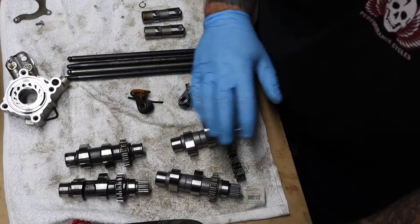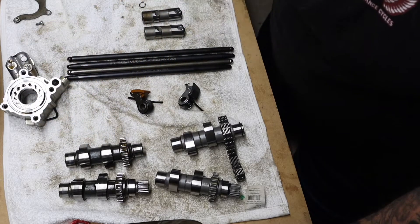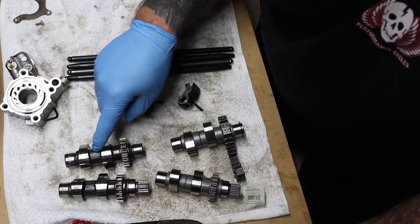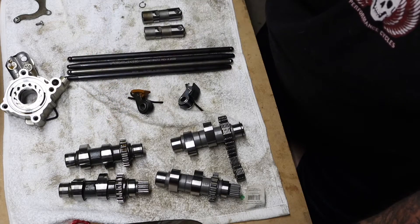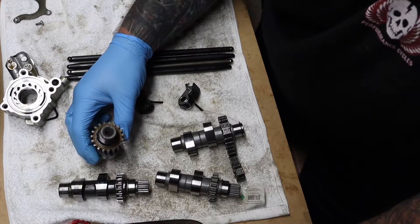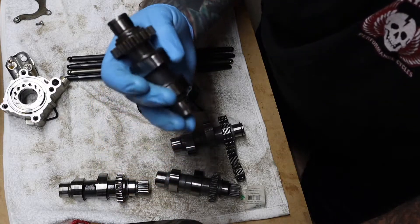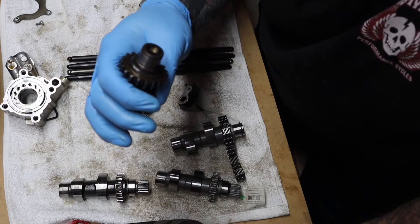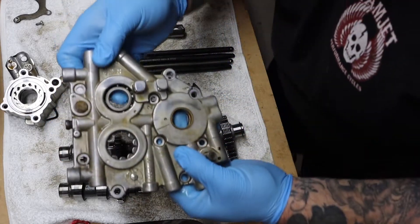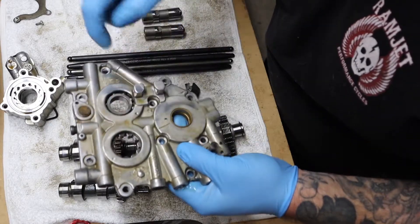Picking up quite where I left off last time — the battery died in the camera. But I think I was in the middle of getting the cams out. I did get these out; I did have to use that brass punch. They didn't damage anything. Not to mention these are just getting replaced anyway, so I'm not too worried. But in the actual cam plate, nothing was damaged even though I am replacing these two bearings anyway.